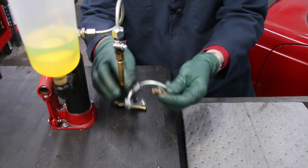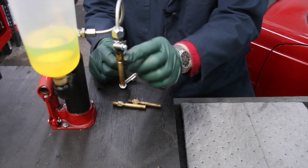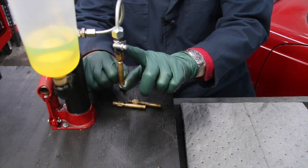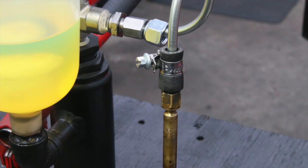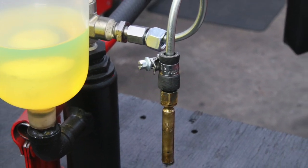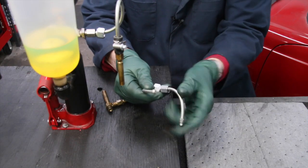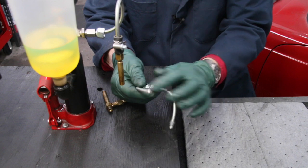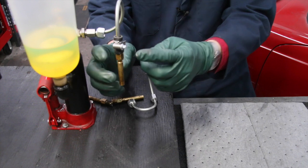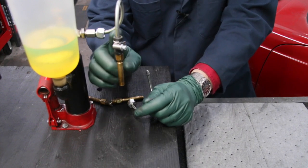Today we went to work and this is what we came up with. We found that if we used a special biodiesel hose with an internal sheath, we could thread the newer style injector right into this hose, and then using a clamp, we could clamp the hose right on the end of this raised nipple on the standard fitting. So it required no modification at all — no extra expense other than a few pieces of hose and a couple of clamps.